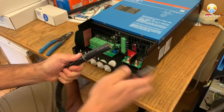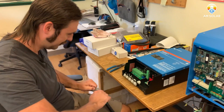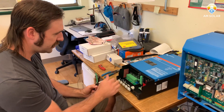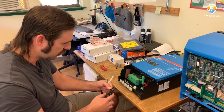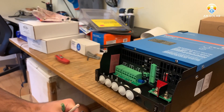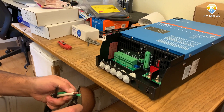Once that pops open, it kind of just goes around and pops off — get a little twist and it comes off. I also carefully use the razor blade to trim these down, always cutting away from any skin. Once that's done, put the razor blade away. A lot of these are going to be the Multi Plus 2, which has a four-conductor, so you're going to have Line 2, which is the red wire. Use the appropriate wire stripper to strip back a pretty decent amount of copper — maybe three quarters of an inch. Go ahead and do that for all of them. Maybe half an inch of copper. Thankfully these newer terminals have a lot of wiggle room, so you don't have to get too particular.